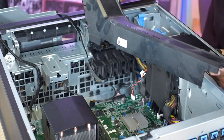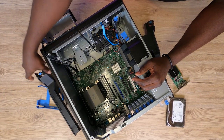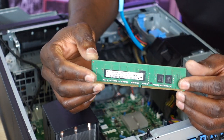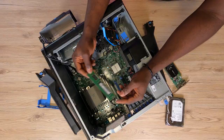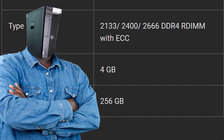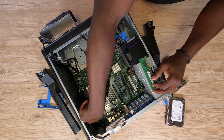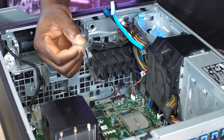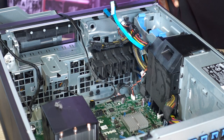We are definitely going to do a lot of cleanup here on this machine. Luckily, I've got my reliable hand blower to take care of that. That's a 4GB DDR4 2133MHz RAM module here — pretty basic. I was expecting to see a much larger and faster 2666MHz DDR4 RAM, which this workstation also supports. This system can support up to 256GB of DDR4 RAM according to Dell, but that would definitely be an overkill for most. It appears we keep getting welcomed by a large chunk of debris, so it's the best time to give this system an initial cleanup.